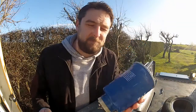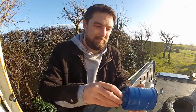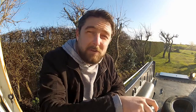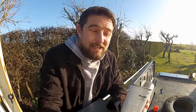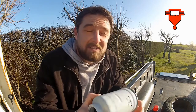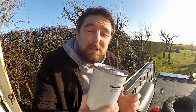So here is the old filter. We need to remove this sensor off the bottom and this should just screw off. This little device is a water sensor, and that's because the secondary function of your fuel filter is to act as a kind of water trap, separating any water from the diesel. As water is more dense than diesel, in theory it will gather at the bottom of the filter. If a substantial amount gathers, this sensor will pick it up and illuminate a light on your dash, at which point you need to remove this filter and discard the contents. Unless you have a handy little tap on the bottom of the filter, which I have seen on some setups - unfortunately no such luck here, so removal would be your only option.